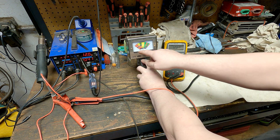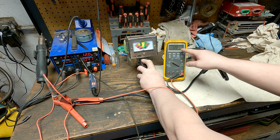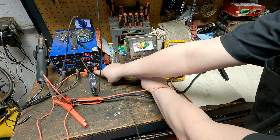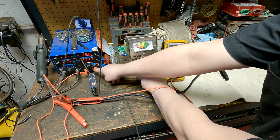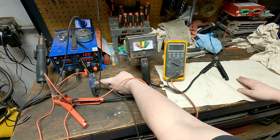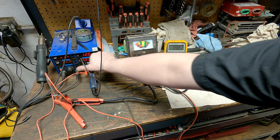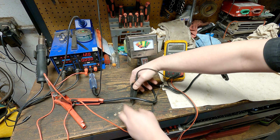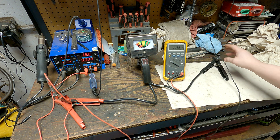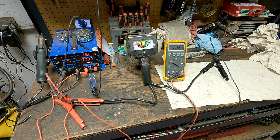The reason it says zero is because the difference between point A and point B is zero, not 12 volts. On the Fluke meter the difference between point A and point B is 12 volts because we have 12 volts on one side but not the other — the other is right at the ground at the power supply. When I release that, the light shuts off and there's no more current flowing. We now have 12 volts all the way through the circuit but there's no current flow, and I'm going to demonstrate that with a jumper lead.